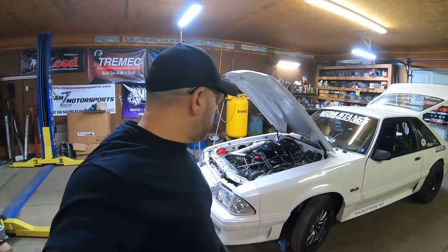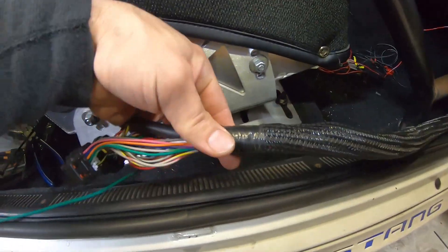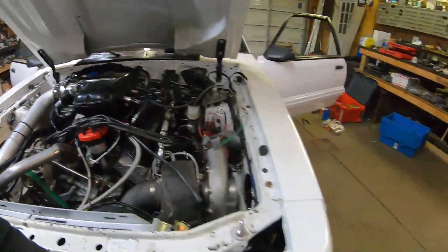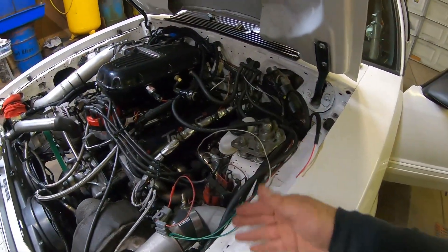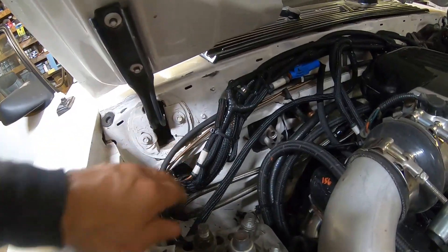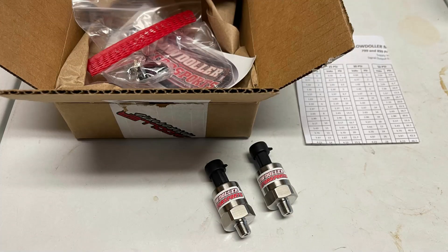We've already written a tune — we'll talk about the tune in another video. Terminator X install: boosted, E85, aftermarket stroker — about to fire it up. I took the 12-volt switched fuel pump wire and ran it back into the harness, zip-tied it, and routed it through the loom going back to the relay. Got the wideband set up via wideband channel two. Finishing up the key-on switch and getting the panel back in the car. Made an extension for the fuel pump relay sensing wire going to the back. Note: at the time of filming I didn't yet have the two sensors for oil and fuel pressure — we received them in the mail today and it'll only take about 30 minutes to set up.